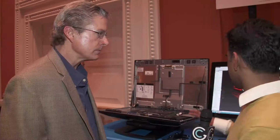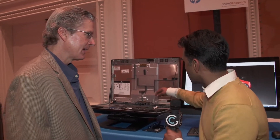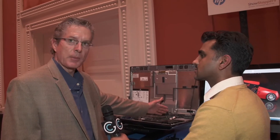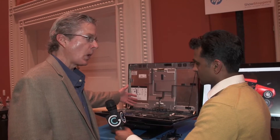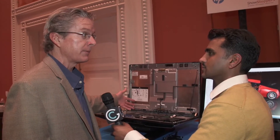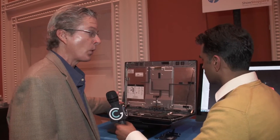Ever since all-in-ones have come out, I've always wondered what it looks like inside, and now you're going to finally get to see it. So it seems like here you've got some RAM — if you want to put extra RAM, you can just plug it in like a traditional desktop. We have four DIMM slots, it supports ECC memory, Xeon processors, Quadro graphics. We have a full lineup of Quadro graphics to support users from Power Office all the way to entry-level CAD, up to those doing high-end renderings.